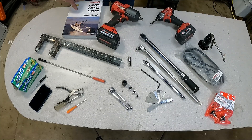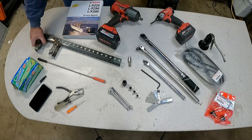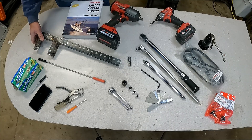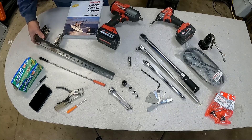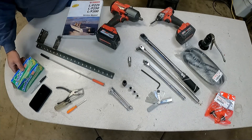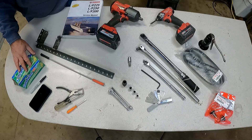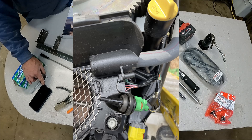This is a service manual for my particular motor — it covers all the 4.2 liter V6 engines. Yamaha sells a tool for holding the flywheel while you tighten or loosen it, or you can just make one yourself. This is a magnet for when you drop bolts you can't reach. For the parts you remove, I highly recommend you bag and tag them in little plastic sandwich baggies with a Sharpie. Also take a lot of photos with your cell phone.